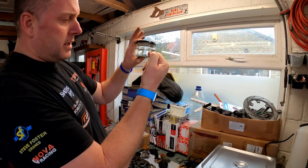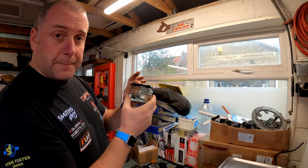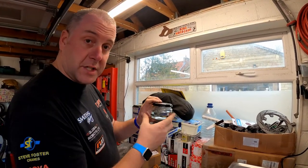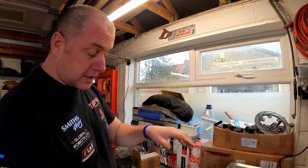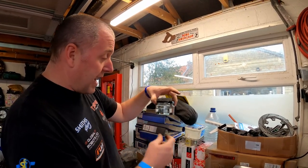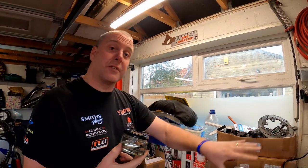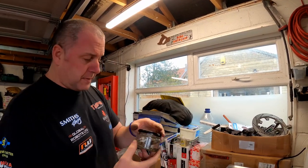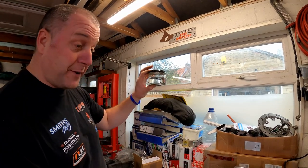Now, as I said, it's the vibrations that do the cleaning. This will form little bubbles inside it in exactly the same way that it will form on anything else. It doesn't have to be free floating inside the cleaner itself. And another good tip that somebody gave me was, if all you were cleaning was little bits like this, you could actually drop the detergent into that, and it would keep the rest of the fluid in your cleaner clean. It's a bit of a no-brainer, really, and I hadn't thought of it. Again, I'm not going to take credit for it. It was somebody else's idea, and it makes perfect sense.